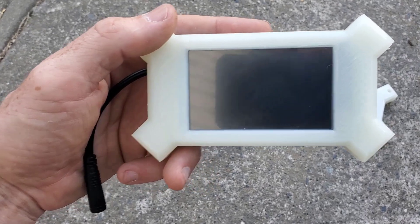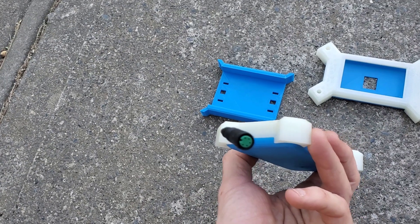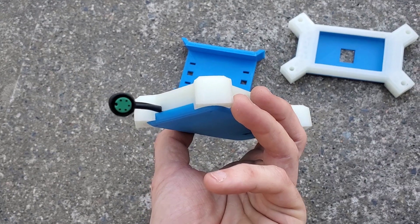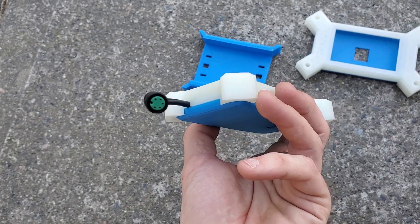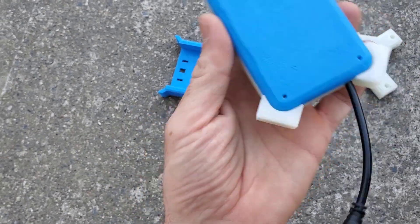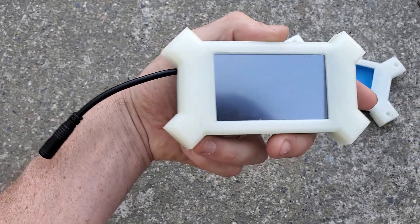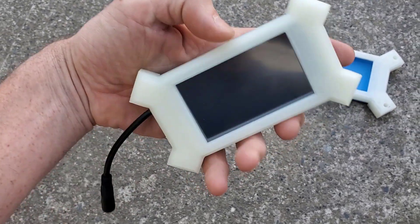I'm back outside because it's ridiculously hot — up to 36 degrees. What I'd like to do is use a different kind of plug for the connection, because the six-pin or five-pin Higo plugs are very good and waterproof, but if you unplug them again and again you can wear them out and run into water ingress problems — the famous 30h error on the BBS HD.